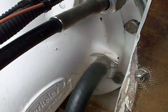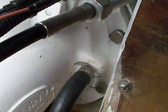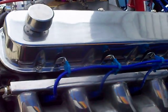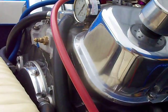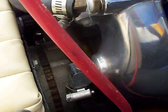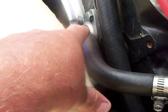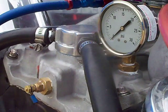The inlet line coming from the jet has a half-inch barbed fitting — that's a Berkeley pump with a half-inch hose, which is stock. Generally it goes to a T which splits out to a three-quarter or five-eighths hose, and that comes up to the exhaust waterlog, goes through the exhaust, heats up the water, comes out the exhaust, then goes into the water pump ports of my big block and comes out the thermostat housing.